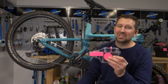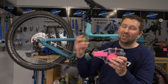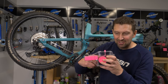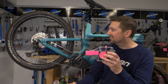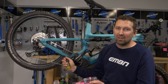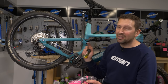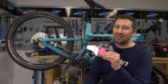A tool I really love for cleaning my chain is a chain bath — these really make it as clean as it possibly can be. All you need to do is put some drivetrain cleaner into the chain bath, clip it over your chain, then cycle your cranks around. The chain passes through a series of brushes and the cleaner, and you get a nice clean chain without a load of mess. You can also go old school with degreaser and a brush, or use a spray chain cleaner — just be careful not to contaminate your pads. My favorite is definitely the chain bath.